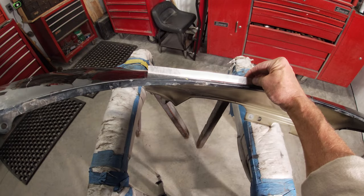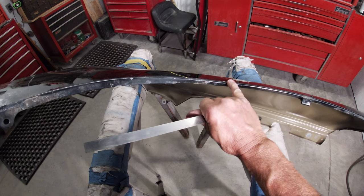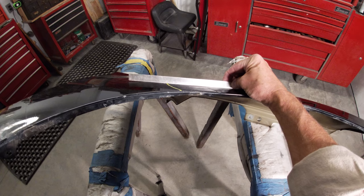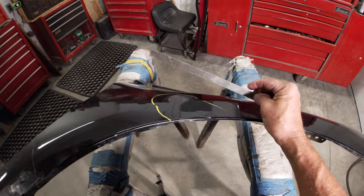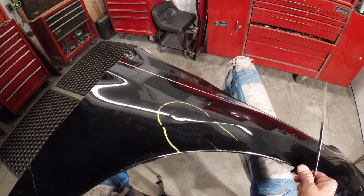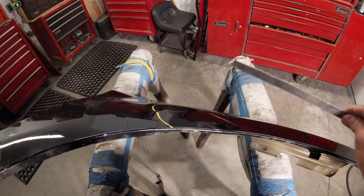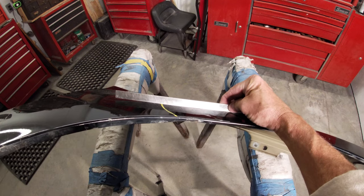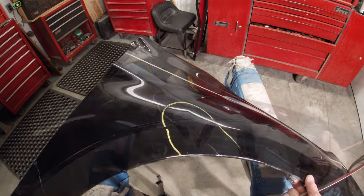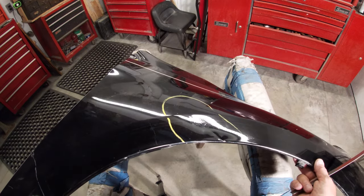With the straight edge, there's very little damage left. This edge right here is a little bit stiff — I'll have to work on that. But it's coming along pretty good. You can still do a little bit more hammering and dollying with the pick hammer, bring this stuff up nice and slow. That's the main thing I wanted to show — just take your time, and this is not overstretched right now. A little bit more work and there'll be hardly any filler at all in it.